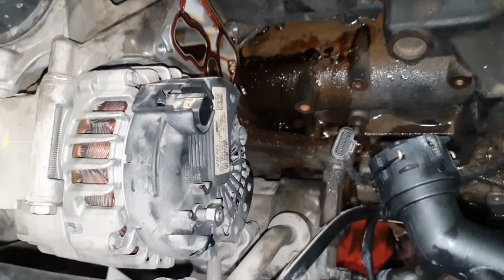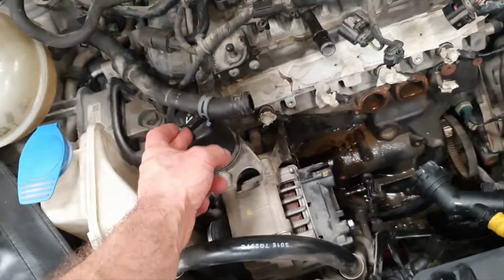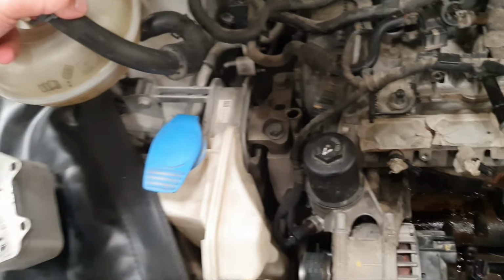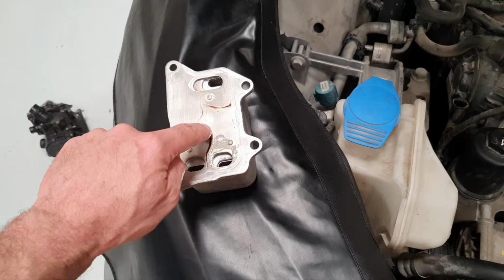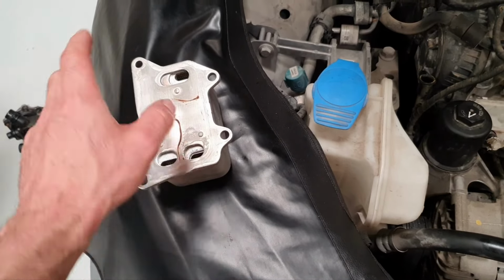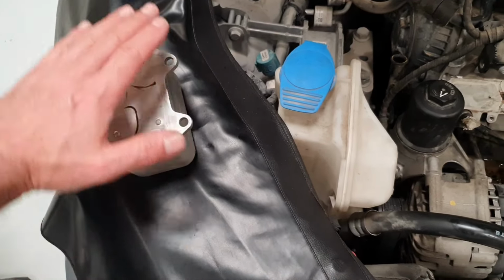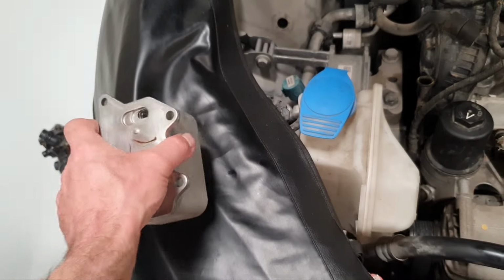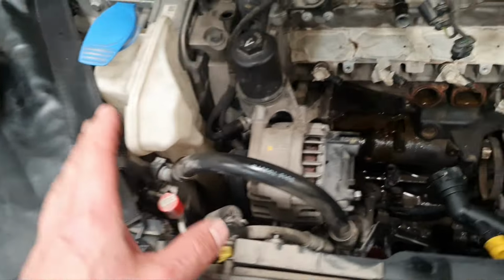And definitely, like I said, Mr. Derek, yes, sir. Here. First, you open the oil filter. You remove the coolant expansion tank from here because it still has some water inside. Okay, take it away. Then, masking tape. I have to clean this piece here and this piece here, without dropping anything inside. And then this, I'm going to take inside the engine room, I'm going to clean this area, and then I'm going to give it to you. I'm going to put masking tape so it doesn't get contaminated. The same thing also from here, from where the coolant is passing. All right, because I believe that the heat exchanger doesn't have any problem.